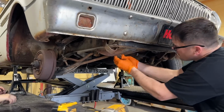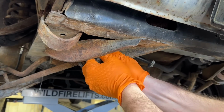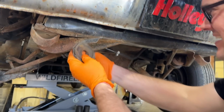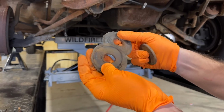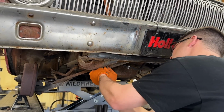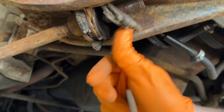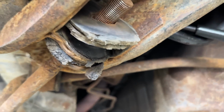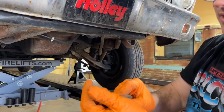Look at these bushings here. It looks like somebody's homemade this one. This is exactly why I was nervous going around the autocross in this car. Look, that's casings. Doesn't that look homemade to you? Every one I've ever taken apart had a solid bushing, like it was a single piece. Yeah, that's definitely homemade. Look, they've homemade that bushing. Look at this side. See, it's supposed to be a solid piece like that. I think that is an old casing that's been cut down, or like a rubber mat out of a truck bed floor or something.